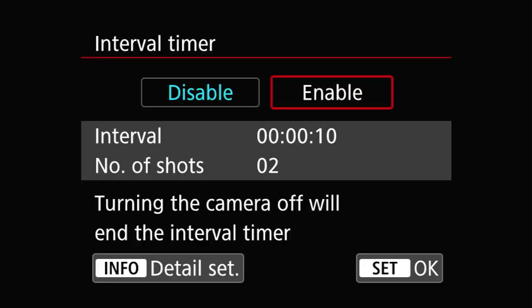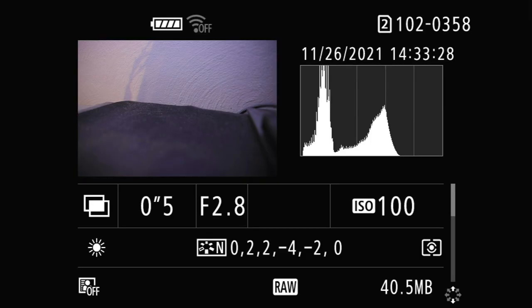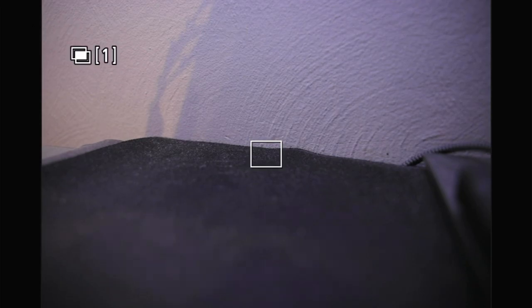Beyond that, the eight-second auto power-off just doesn't seem reliable when the interval is paired with any multi-shot operation, such as auto-exposure bracketing and multiple exposure mode — the camera appears to just ignore the shortened power-down time completely. What's bizarre is the firmware was clearly updated with mirrorless in mind: it detects the interval timer is active, detects that auto power-off is set, and makes some changes — but simultaneously wasn't updated to remove the superfluous power cycle. While Canon says the interval timer can be combined with bracketing, multiple exposure mode, or HDR mode, it just doesn't work right. What you'd expect is for the camera to shoot the entire multi-shot sequence at each interval. Instead, what happens is the camera shoots one frame, and behavior after that depends on the mode — in AEB, it moves on to the next interval; in multiple exposure mode, it does one exposure per interval, so it may never complete the shot.